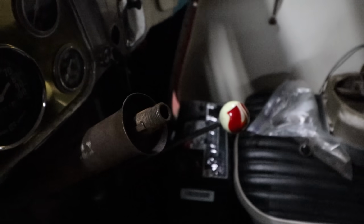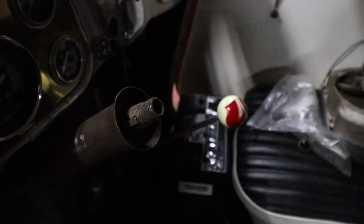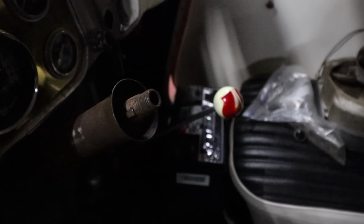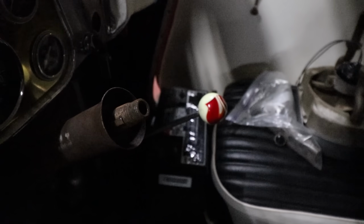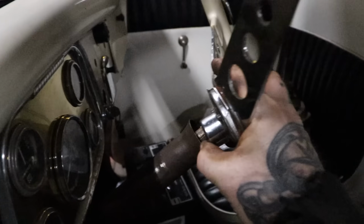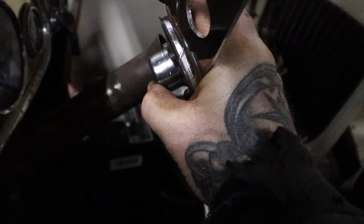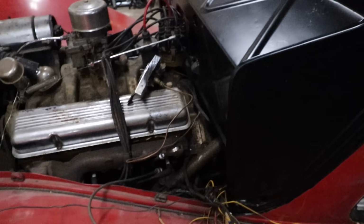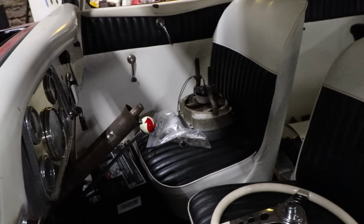So on top of that, and also it being a little sloppy, I think what I'm going to do is extract that bushing and machine up quick one of my own oil impregnated bushings. I got a little bit of that I use on pretty much all my cars for bearing type material. So we'll knock that out, and then we can machine that so we can tap it down as far as we need it to go, so that the steering wheel here will marry up and sit back, almost touching that bell, something like that. So that should be pretty cool. We'll get this off, knock that bushing out, and then I'll quick machine something up on the lathe, and we should be ready to rock and roll and mount the steering wheel finally.